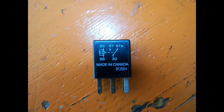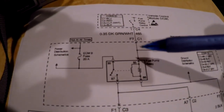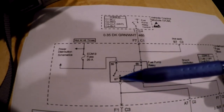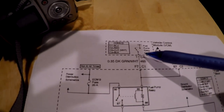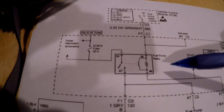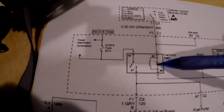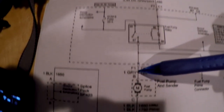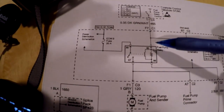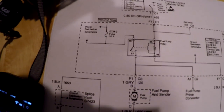Here is a picture of the relay, and this is on the underside — remember 30 to 87, so we are going to go diagonal. On your wiring schematic you will see pin 30 here, jumping that to 87. Whatever you do, do not touch pin 85 with power because that goes right back to your PCM and you can fry it. The PCM turns this relay on, which closes this switch, and this is wired hot all the time — it routes it down and turns on the pump. Stay away from pins 85 and 86; the one you want is 30 to 87.